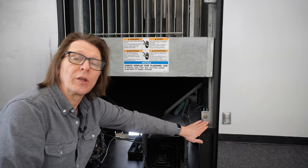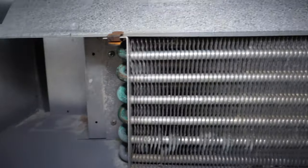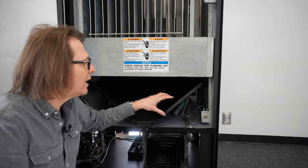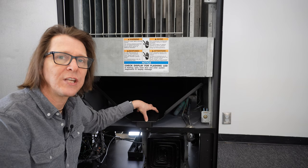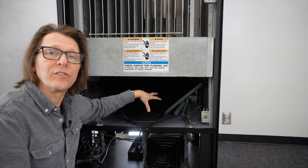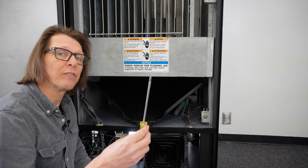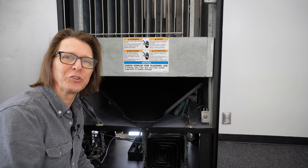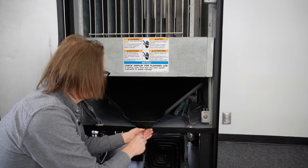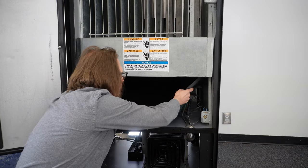On the Dixie Narco 501E, this thermostat is located on the right-hand side. You can also find them on the left-hand side, as well as actually attached to the left and right-hand side of the evaporator coil itself. Here I've located my thermostat. In this video I'm going to remove the delivery chute and the cold box cover so you can see how the capillary tube gets mounted in. I'll use a Phillips head screwdriver to loosen these two screws and get this delivery chute out.